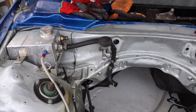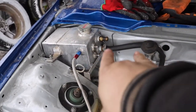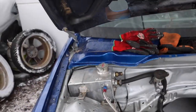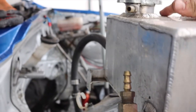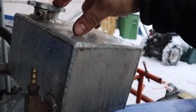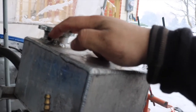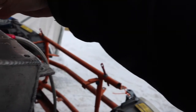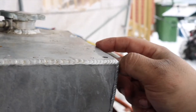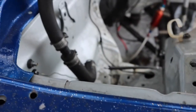The coolant — I'm still thinking what I'm gonna do because now I bought a Wilwood brake pedal that's coming into the engine bay, so I'll have two Wilwoods right there. Basically I gotta eliminate this or make it smaller. The way GD made this was: this is part of your cooling system. You fill your coolant here and it's the highest point of the car. Right here is your expansion tank, so it's two different boxes made out of one. Coolant overflows into this fitting and then once it gets too hot it blows out of this little hole. I don't think that's legal, so what I'm thinking is just cut this expansion tank off and then maybe I'll have room to run this section right here and still have room for the Wilwoods.